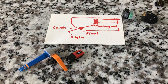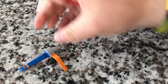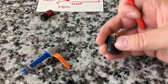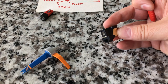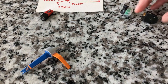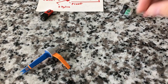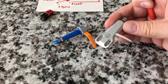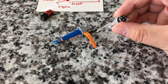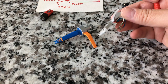Now let's talk about the stylus itself. There are two basic types: nude and bonded. A nude stylus is one where the entire material making up the stylus is diamond or ruby — the whole piece. Those are called nude; they're more expensive, and some people swear they can hear a difference. The Ortofon 2M Blue is nude, meaning the entire stylus is a solid chunk of diamond. Most of the others are bonded, where only the small tip piece is diamond glued onto a cheaper metal shank — only the tip contacts the record.